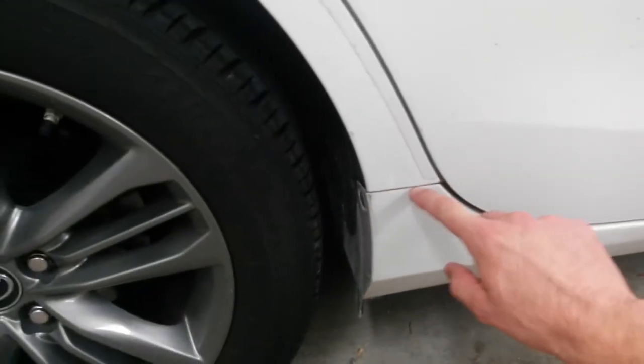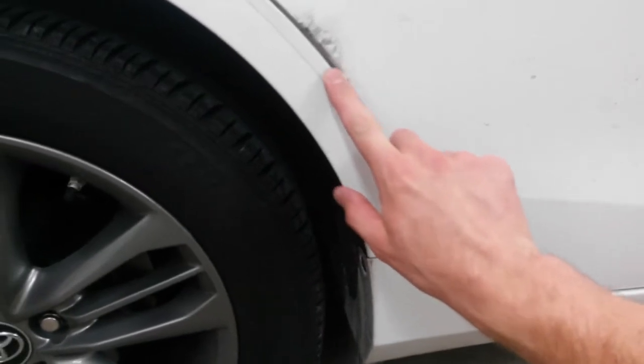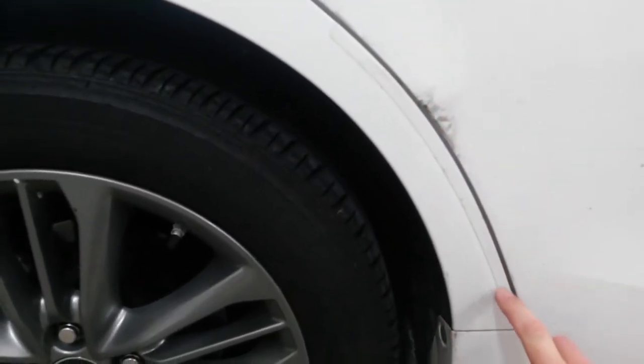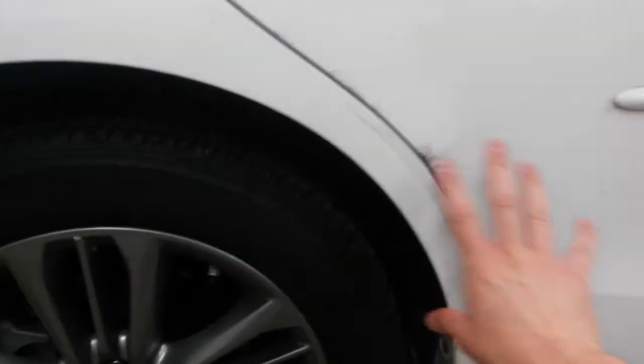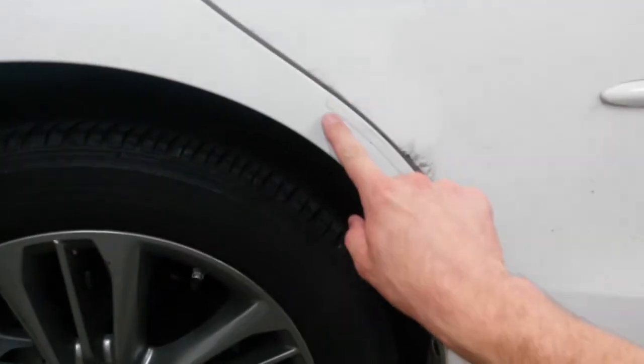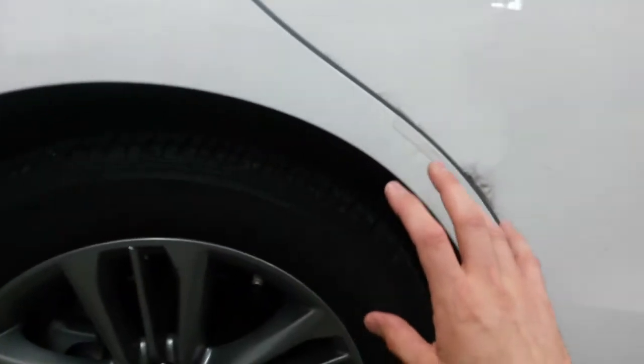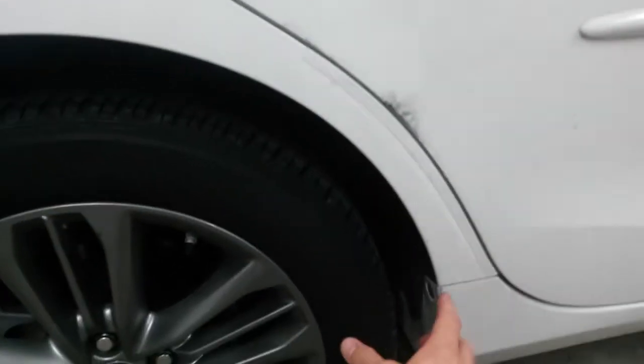Really, that's the only thing you got to take out is the tail light, but I'm going to have to paint all the way down to this seam here, and I'm probably going to leave this decal here because that thing there is not really all that expensive, but I'm not going to put color really down in here, so I can just scuff around this edge with a fiberglass pen and sand it just like I'd be doing a clear blend or a color blend over into here, and just clear all the way down to this edge.